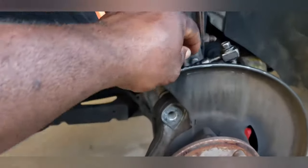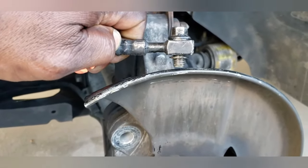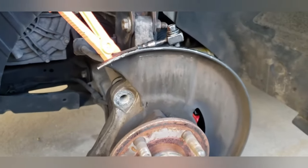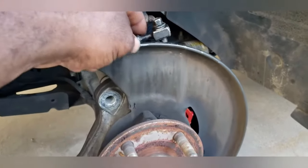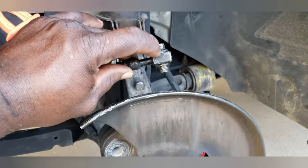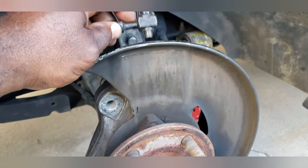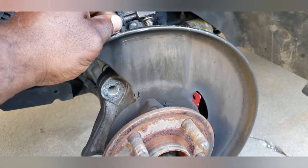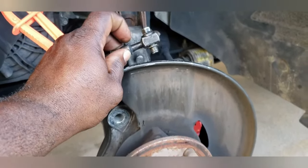Looking closely at the inlet valve, there's a gasket on the bottom and a gasket on the top. So that's why there are two gaskets in the box. You have to use both gaskets, one on the bottom and one on the top. I'll try to get these off to put the new ones in. If I can't get it off, I'm just going to reuse it, which is probably not the most wise thing to do. Nope, I'll get it off. Never mind.